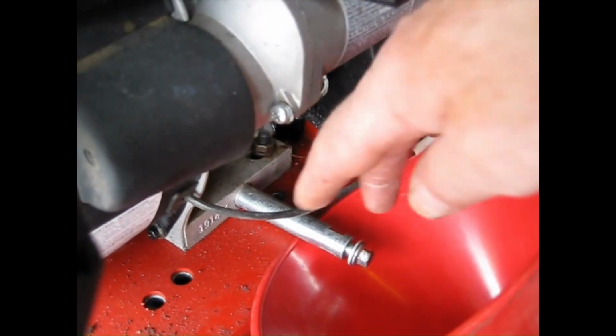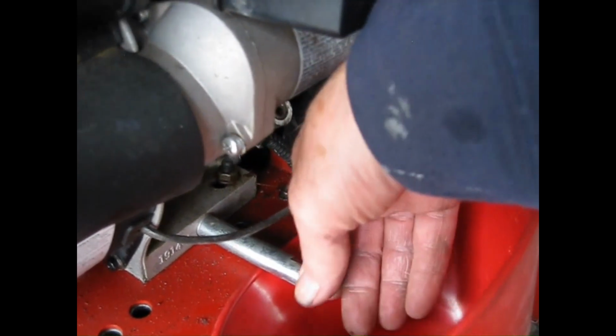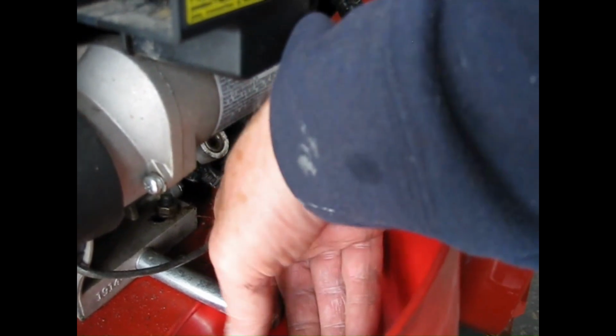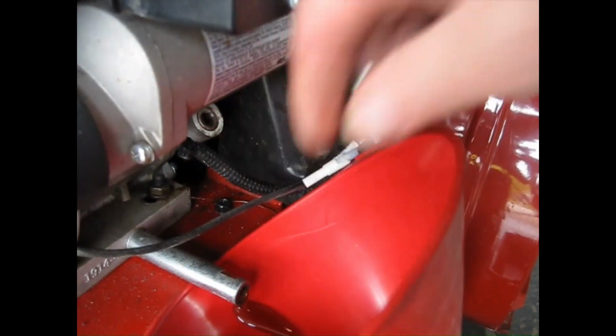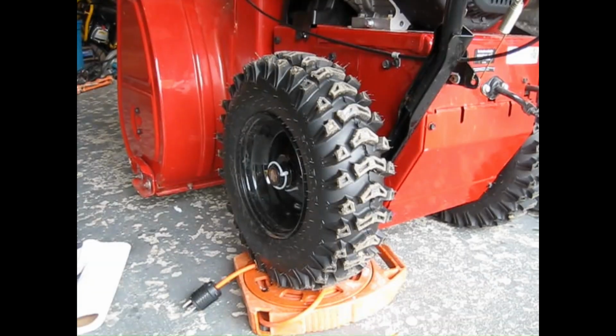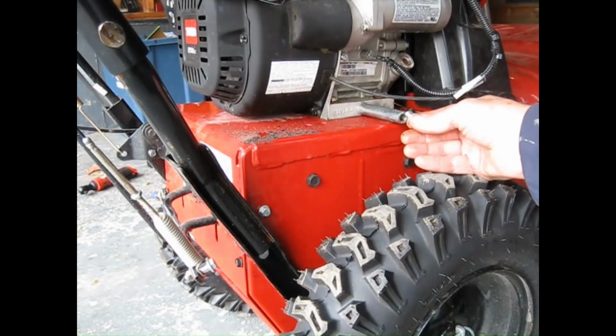So I have it jammed underneath the pipe. I have this finger tight. And this should be 0.6 of a liter, I believe. So 600 ml. And we'll just take the cap off here and let it flow. There you go. As you can see, it'll drip right into my drain pan. Put something under the opposite wheel to help it drain quicker.